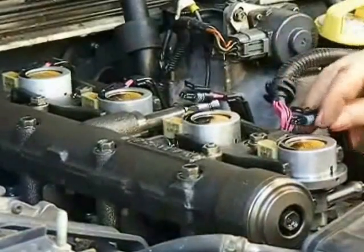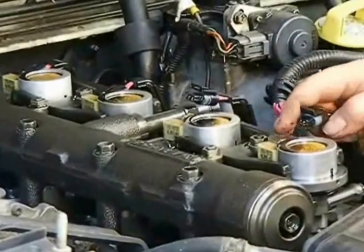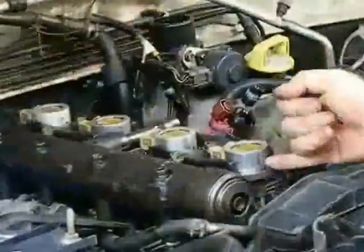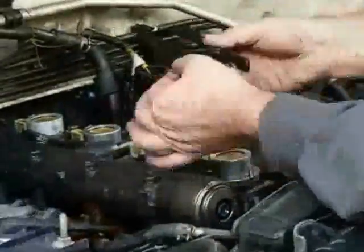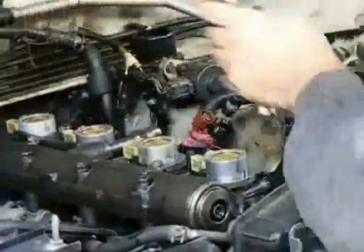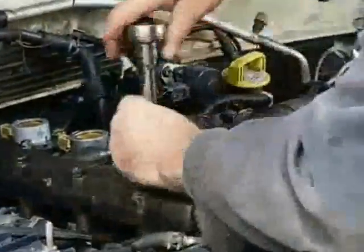There's the common rail. Observe the connections on the injectors — I just checked them, the little neoprene seals, I'll probably replace them. Drain the oil from the oil rail. There's the drain plug, it's the front bottom. Loosen off all the bolts — don't take them out yet, just loosen them all off, including the injector mount bolts. And take off the H-clamps on the injectors.